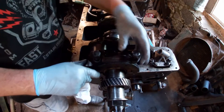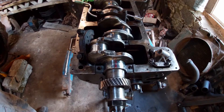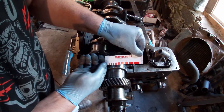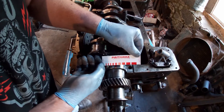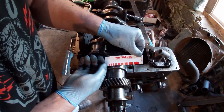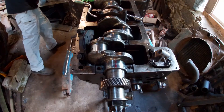That should have crushed up the Plastigauge. Yep, that's flattened that out. What you do now is take this card and match it to the width. That's saying it's got four thousandths in it now — so that's even bigger. Three and a half maybe — that's not far off. Slightly bigger than that one. About 3, 3.5 thousandths I would say. So I'll just clean that off and torque it up again.